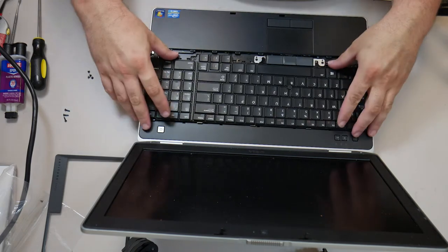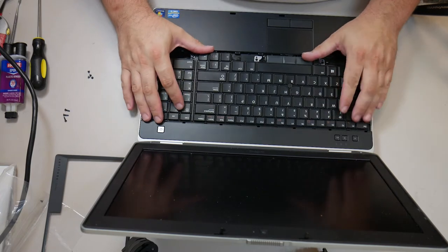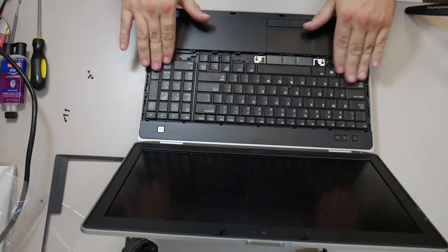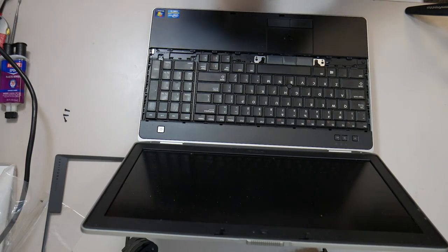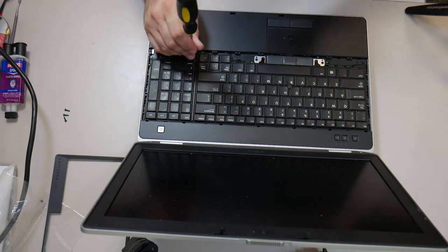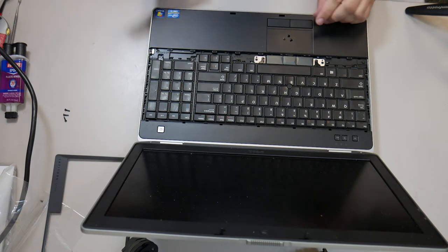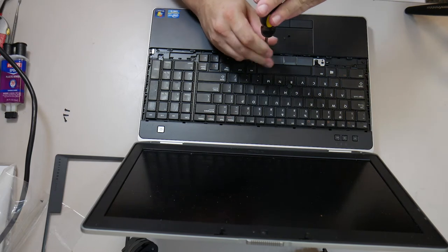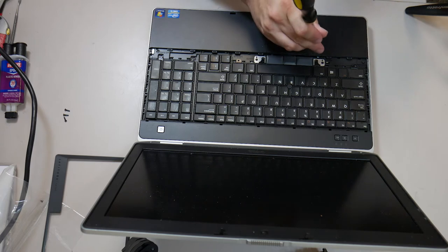Unfortunately you couldn't see me do that, but that was locking the data cable back in place. You slide the top tabs in. You push the keyboard down. There are some plastic clips that hold the keyboard on the sides too, but they're pretty easy to engage. Throw a billion screws back in the keyboard, because that's what we like to do with our lives, twiddle a screwdriver in the same motion over and over.